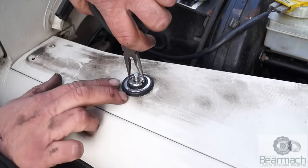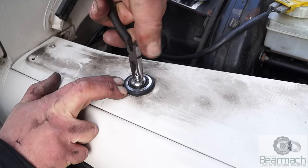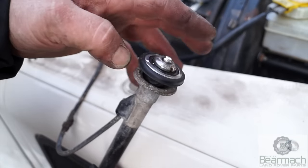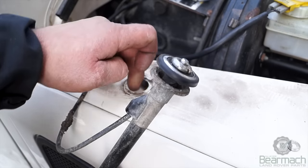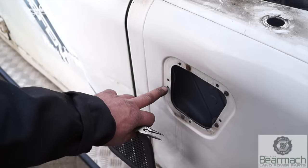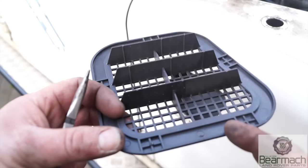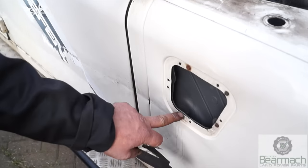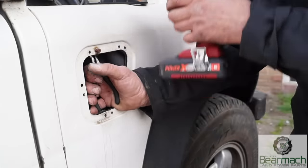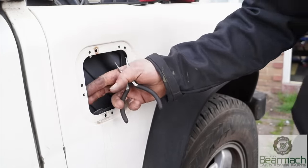The aerial is quite easy to remove if you understand how things undo. Screwing out the center of the aerial, we found once we'd removed it that the aerial was more than useless because it uses an earth on the wing - you can see it's corroded here. This is something we're going to chuck away and put a new one in. This panel here is a bit of a nightmare because it has pegs on it which push in. There's a very big risk of snapping them pulling it off, and that's exactly what happened. Rusty screws actually expand and grip a lot harder even in plastic, which is why I'm using a pair of pliers on the plastic fitting at the back to undo the screw.